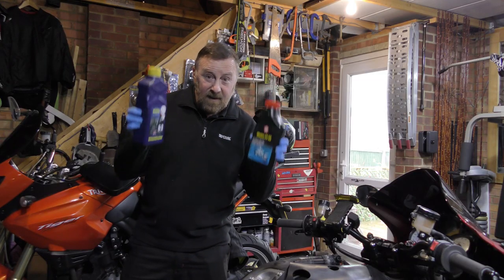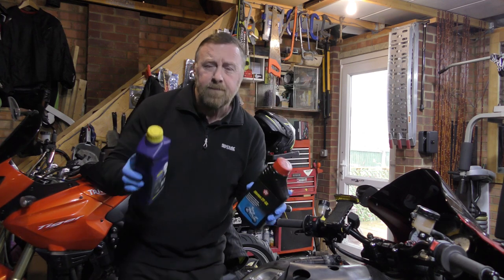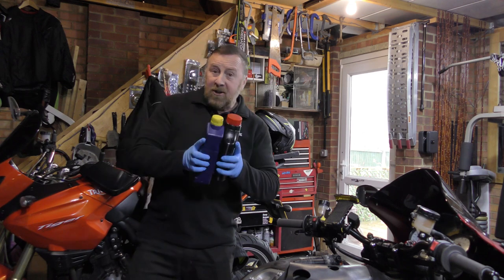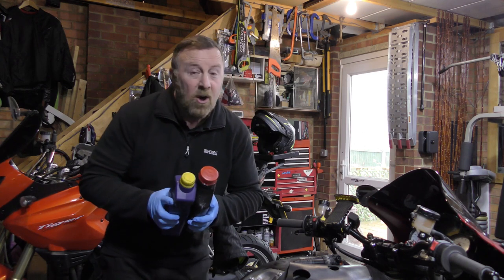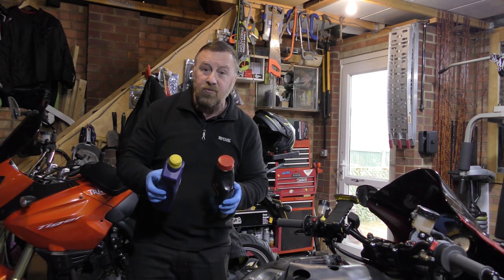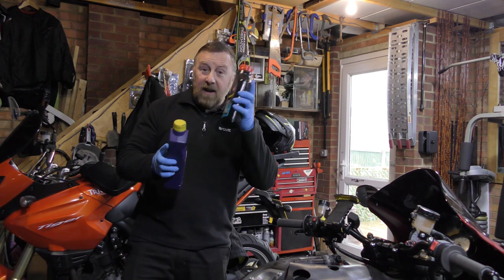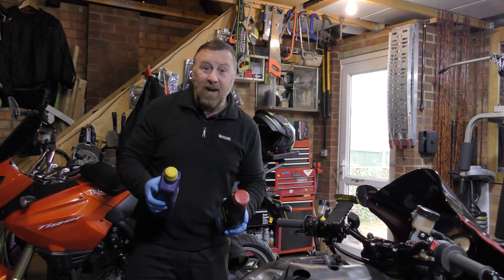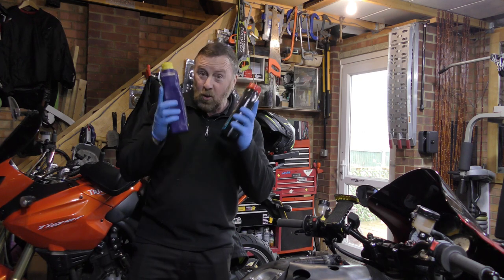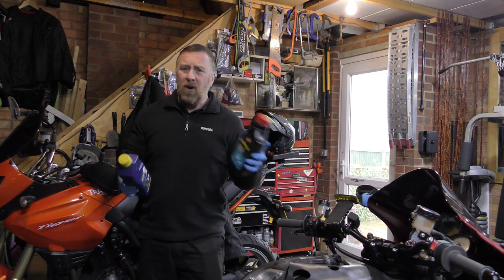Add into this your 2T oil. People ask me, what's the best one to use? You've got your Putoline, your top brand makes, your synthetics. Make sure it's E10 compatible, because a lot of them aren't. It doesn't mix with E10. When you pour oil into petrol and shake it around, it all goes red or green — whatever colour it is. With E10 this doesn't happen. It sits there and you're getting full natural E10 through your bike, or you're just getting big blobs of oil come through because it's not mixing — and that's causing damage as well.